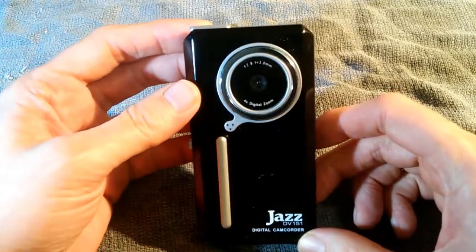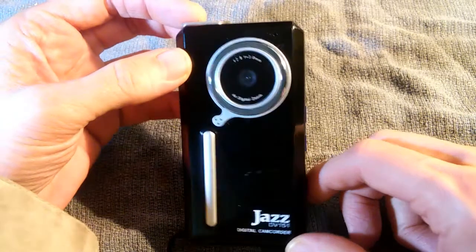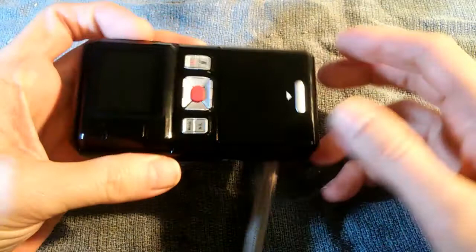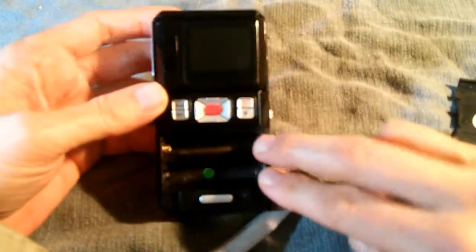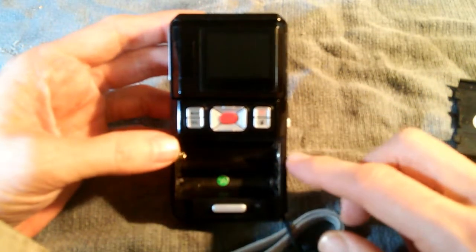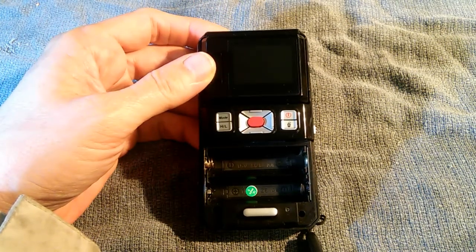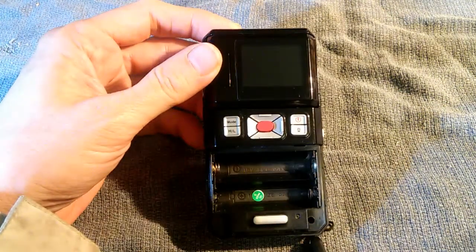Manufactured I believe in the 2007 or 2008 time frame. When I got it home, of course it did not work — it was completely dead. So I opened it up. You depress this button and slide this over, and there were two heavy duty batteries in here, both of which had leaked. There was zinc chloride leaked all over the place. I removed the two leaky batteries, put in two fresh alkaline batteries, and it still didn't work. So I'm going to need to open it up and see if I can bring it back to life.